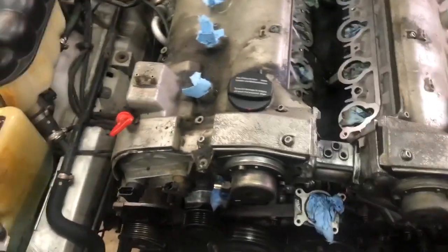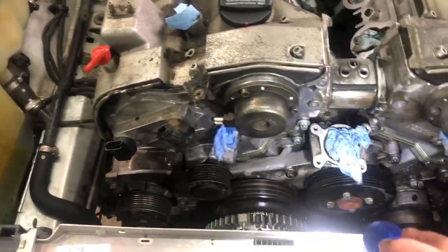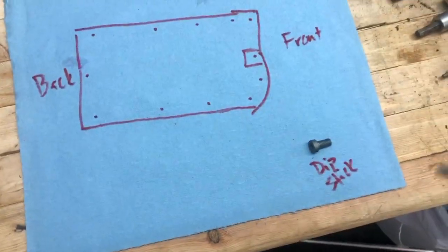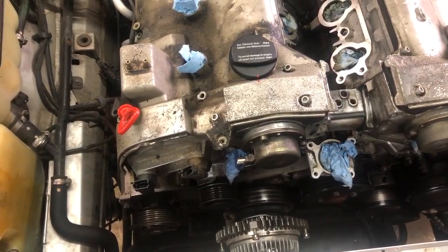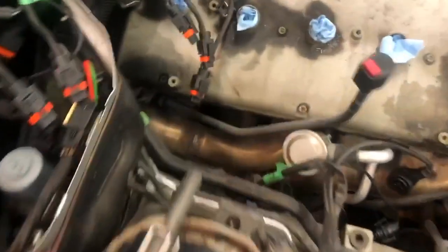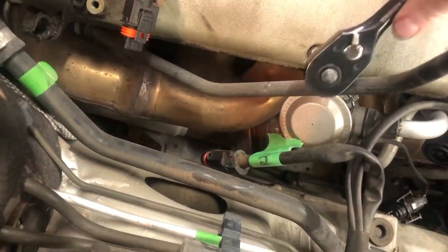Some developments - I've been cleaning tons and tons of engine oil off here. You can see those seals, those could be the culprits, but I'm not entirely sure anymore because I just stumbled on a new development. I was drawing the valve cover so I could keep track of the bolts, and I had just removed the dipstick bolt. I took my wrench, put it on this bolt - it was loose. Then this one was loose, and this one, and this one. I haven't done this last one yet, so I'm curious how much effort it's going to take to loosen that bolt.